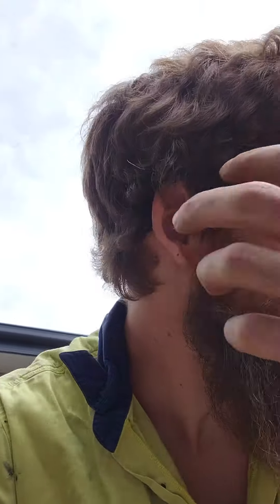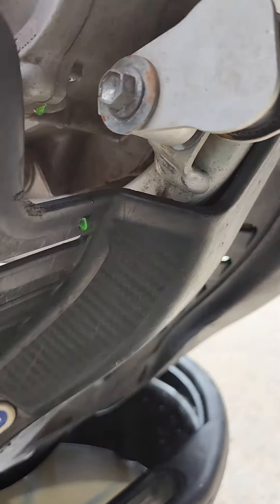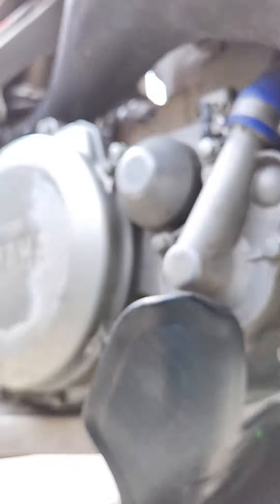The other day I was out on the tracks and I started noticing a bit of coolant smell. I first suspected that my water pump seal had been letting go, like the actual outer casing seal, but it turns out it's the inner seal. On the bottom here there's that little hole — see how the coolant is actually coming out of that hole? That means that your inner seal is gone.